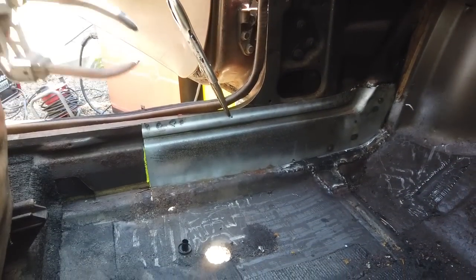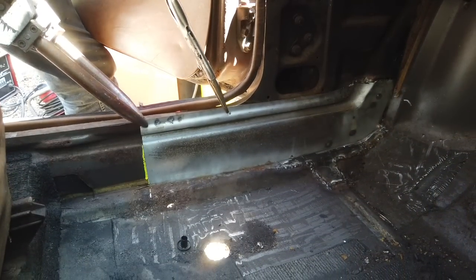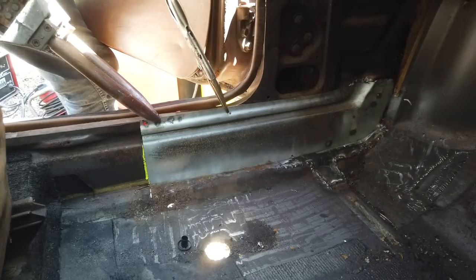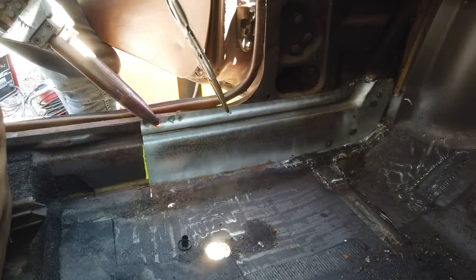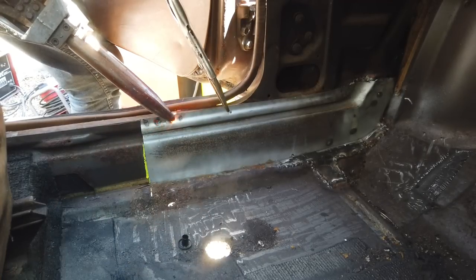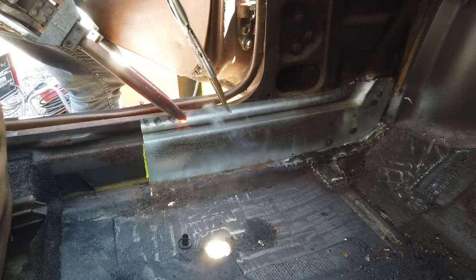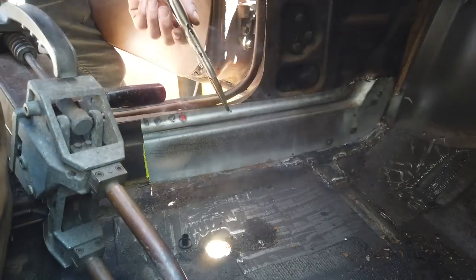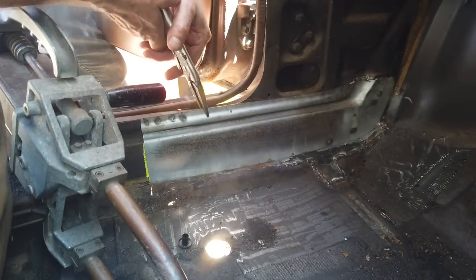I've cleaned the ends of the spot welder, the parallel tips. I know these have been done, but I'm just doing them again with a clean tip. I noticed the tip wasn't clean, and it was making an uneven spot weld. So it's a lot better now. Boom! Hell yeah! They are nice spot welds. Very nice and deep spot welds those.